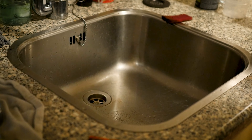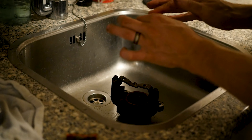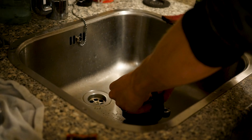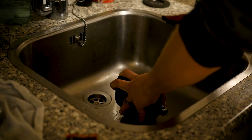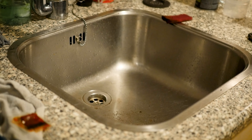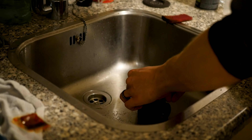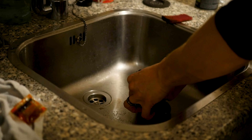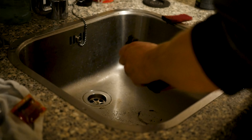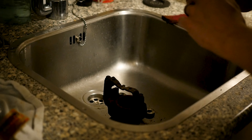After carefully placing them in the corresponding grooves, it's now time to grease up the piston itself and then apply the dust cover. The trick is to get the dust cover in the caliper and then jiggle it around so the dust cover doesn't pop out of the caliper. But getting the piston into the caliper was quite a struggle, so I didn't end up filming all of it since I could use all the light — it was already dark — but eventually I got it all in.